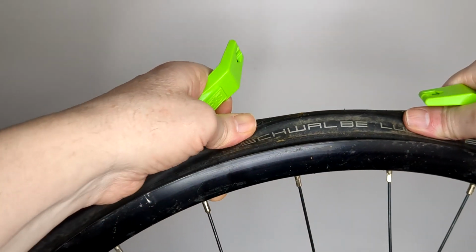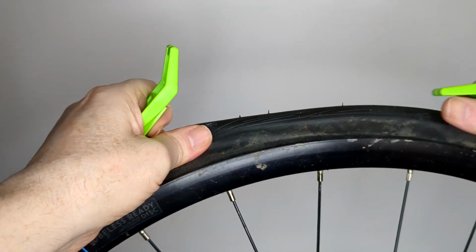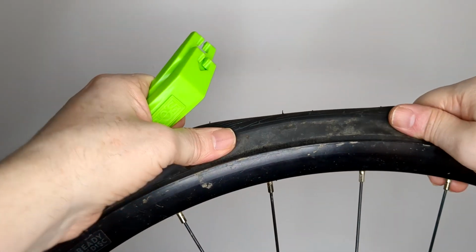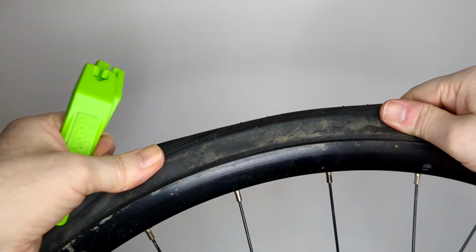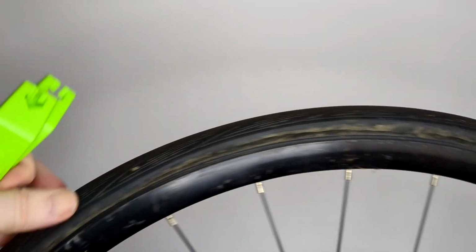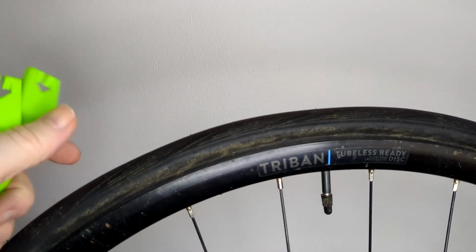Yeah, I think I'll make a few videos about this scenario anyway, but I just wanted to make that point clear. If you're buying a tubeless ready wheel for the first time, be prepared to realise that one side of the wheel or both might stick to the side. Stick's the wrong word. I think it's airtight, sort of fell into a groove, and you might have great difficulty removing it. Because my tyres are 32mm maximum, I managed to get this one to go. But I don't know if you've got a mountain bike tyre at 50mm wide, it's really thick and heavy. So I don't know if that's what the cyclists were talking about in the forum, that sometimes on tubeless wheels you'll need to cut them off. I don't know if that's true or not, I'm just putting the myth out there.